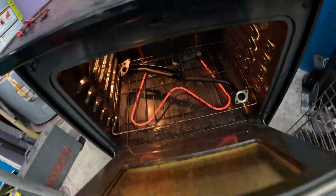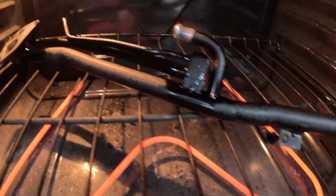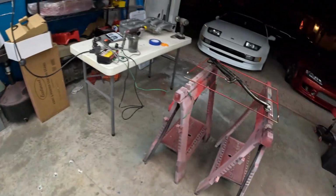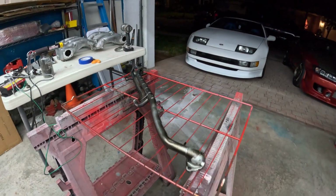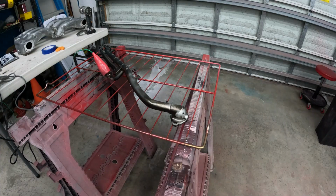All right, guys, we're looking good. Our powder has started to flow. You can see it looks like a liquid form there. It's already starting to even cure all the way. I'm gonna pull it out and flip it over and do the other side. All right, that's what our top side looks like. We gotta make this pretty. So I'm gonna spray it down.